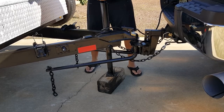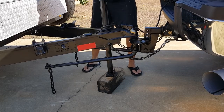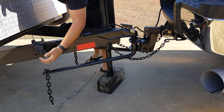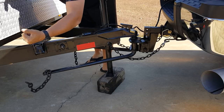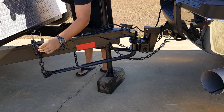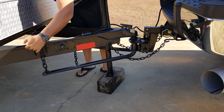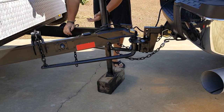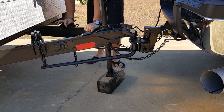You've got to get it pretty high — you can watch, it's going up. You'll want to play around with this adjustment for whatever you think is the right preload. This is an older style; the newer style have a pin that the chain link goes over, and they've got a rod that helps you pop them over. I've done this enough that I know I need three links showing — so I'm at three links. The higher you crank it and the closer you get the arms to the bottom of the rails of the trailer, the easier it is to lock your brackets in.